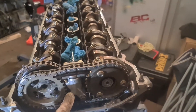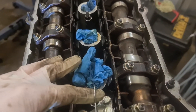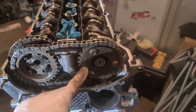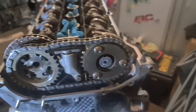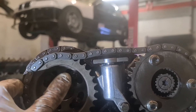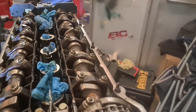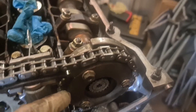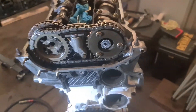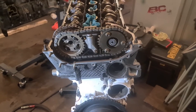All the vanos chains and sprockets are on. The tensioners are on at 10 newton meters. Basically you put on your two sprockets at a time with the chain. When moving them loose, move it completely to the left and the bolts should both be on the right; move it completely to the right and they should move all the way to the left. When you put this on there's like a 4mm shim, then a spring washer and a 2mm shim, then bolt that on to 10 newton meters. Next is just to get the vanos on with a new gasket and a bit of RTV sealant.